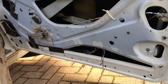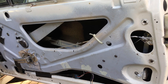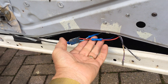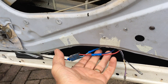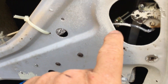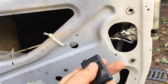So just a quick video on how to retrofit central locking onto a classic car, and also how to overcome sticky central locking on other cars. Where you're wiring into existing wiring, you have to test it to make sure you've got it the right way around — try it both ways to see which works for locking and unlocking. Where I've doubled up the solenoid, here's the little connector block clamped onto the rod.